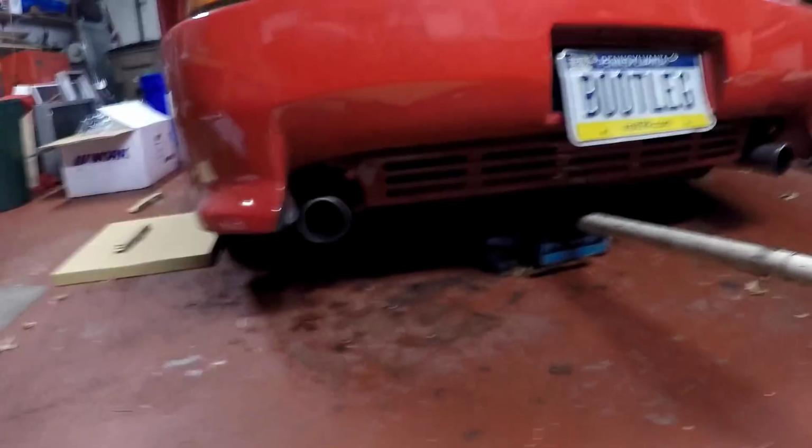Alright, so I'm just basically gonna dive right into it. I'm gonna jack the car up, take the wheels off, and test fit. Always remember to make sure that your e-brake's on and it's in gear. Excited to see, after I take the wheel off, the wheel and tire compared to just the rim, the 19s. It's just so aggressive and out of hand. It's gonna look gangster AF.